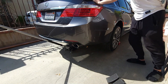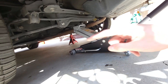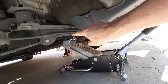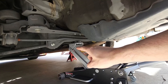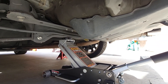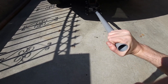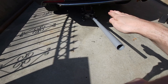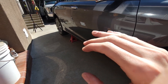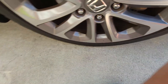Next, come to the vehicle and give it a push to make sure it's stable on those jack stands. The weight of the vehicle is now resting on the jack stands, but the floor jack is no longer touching the subframe. I want the floor jack to have just a little pressure on that subframe as a backup measure should something go wrong. Turn clockwise to the right to make sure it's tight, so it doesn't fall down. Once that's done, the vehicle shouldn't be moving anymore with the weight resting on the jack stands.